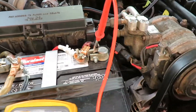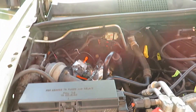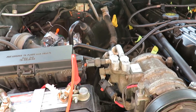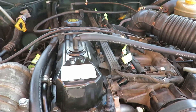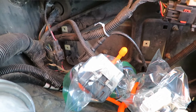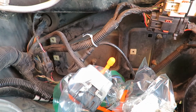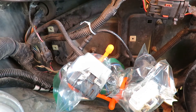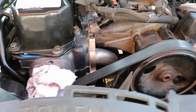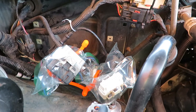After that arcing situation, once I got everything put back together and the battery connected, I went to start the vehicle. When I turned the key, none of my gauges in the cluster illuminated. That told me the computer was shot. I knew this because the same thing happened about 10 months ago — the computer got fried twice due to shorts in the light switch area.